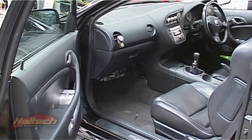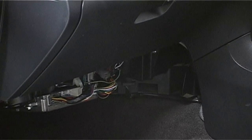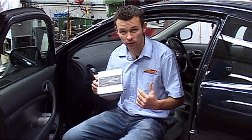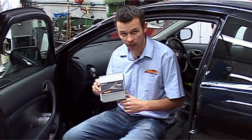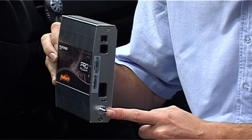The standard Honda computer is located below the passenger side glove compartment in this motor vehicle and it's attached by three 10mm hex headed fasteners. This vehicle is naturally aspirated from factory, although turbocharged applications are catered for by the 22 psi map sensor built into the ECU.